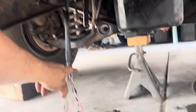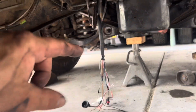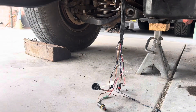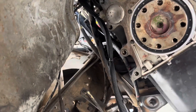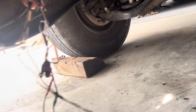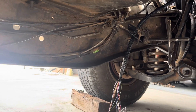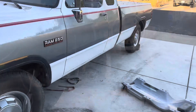There it is, wire loomed up — looks a lot better. I didn't go all the way down to each plug because the plugs have to go to individual spots on the transmission. I believe I have to switch out a few of those plugs to the second-gen style 47RH, but I got it loomed all the way up the motor just to keep it protected from vibration and rubbing. I'm going to set it aside so I can get the adapter plate installed and the flex plate. I'm getting ready to pressure wash the adapter plate right now — it's pretty greasy and you don't want to put greasy parts back on a fresh clean motor.